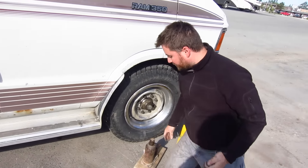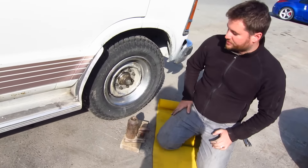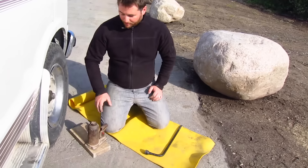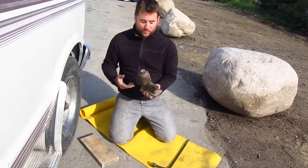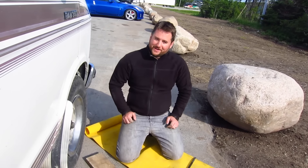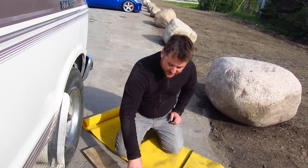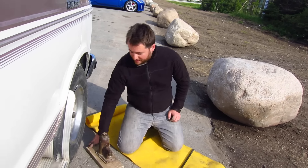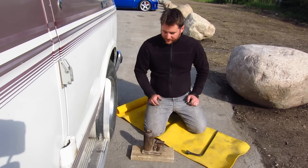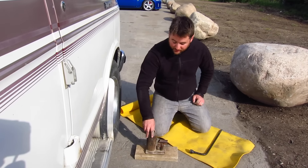So this is the jack we use to jack up the van — it is by no means ideal. We should have a proper axle jack that has a little cup here that cups the axle to lift it up. But this is a really old jack that is super reliable, the proper weight for our van, and it's what we had — and thank goodness, because we've had to use it a lot. Because it's got a small base it rocks a little bit, so it's a good idea to put it on a piece of 2x6 if you can, so it's a little more solid. When we were on a gravel road a couple days ago this would have been a pretty big risk without the 2x6 underneath it to stabilize it.